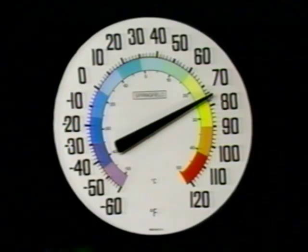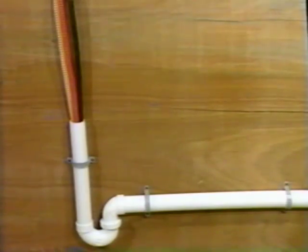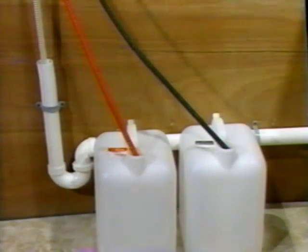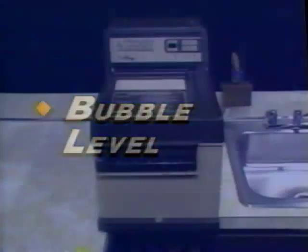Let's begin with an installation check. Check that the temperature in the dark room is less than 80 degrees Fahrenheit. The AT2000 Plus generates heat when processing film, so it's important that there be adequate ventilation. Check that the drain hoses slope downward with no U's or upward bends, and are inserted into either an open drain pipe with hoses ending at least six inches above the water level, or into recovery containers with the hoses also ending six inches above the solution level. Check that there's at least six inches clearance above the AT2000 Plus so the cover can be removed for service and maintenance. Check that the AT2000 Plus is level — the bubble in the bubble level should be centered. If it's not, turn the leveling feet until it is.